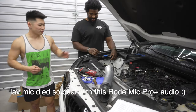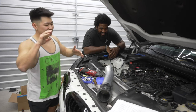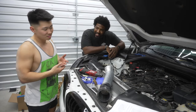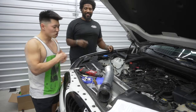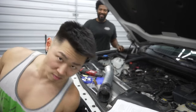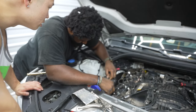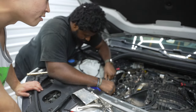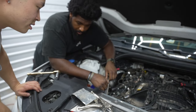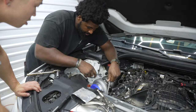After an hour, we realized Ishmael forgot a bracket - took about 45 minutes. It's a bracket that seats the nuts onto the exhaust manifold so the manifold sits on the studs on the head. All we gotta do now is clock the turbo, put the down pipe and intake on, drain and fill lines, fluids, tune, and we're good to go. We are currently fitting up the drain line and feed line, and we've bolted down the turbine housing. Next step is to figure out where to clock the compressor housing, along with the intake pipe and boost pressure reference.